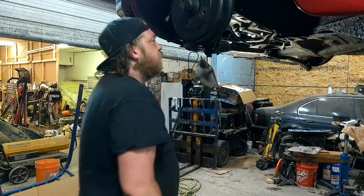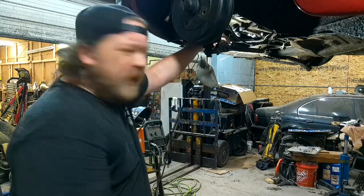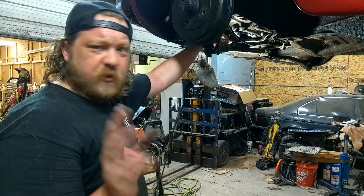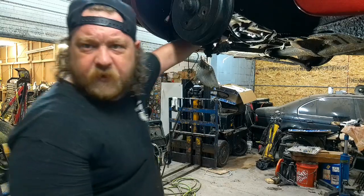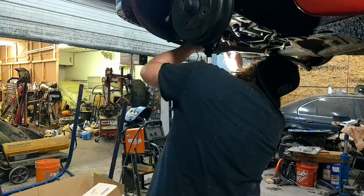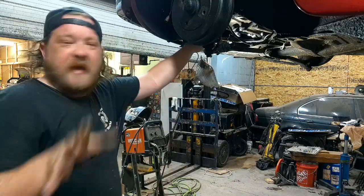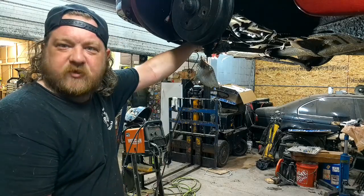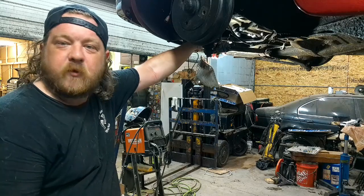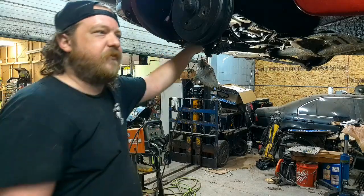All right. Let me get this master out. I do actually like the Super Beetles a little bit better than normal Beetles. You have more access and only 2 lines to worry about screwing up versus the 3 on the standard. Because if you didn't know, if they get teed and split. Is that leaking? Oh, don't be leaking. It's not. We're good. Anywho, I'm just gonna swap the master. I'll show you the aftermath if you don't believe me, but it's hard to record from under and over and every other direction.